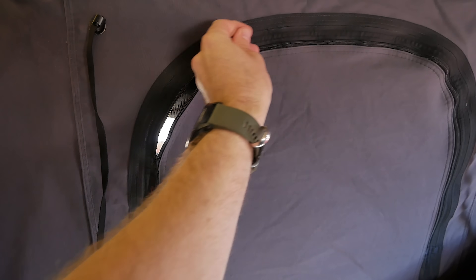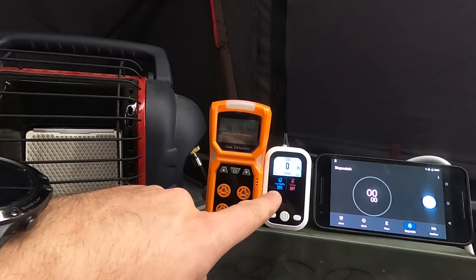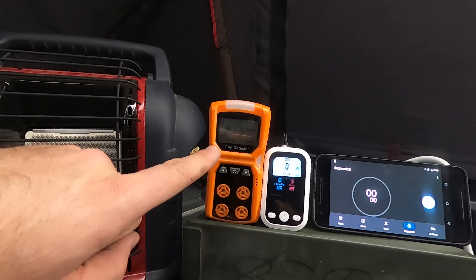What I'm going to do differently than when I normally camp is close up all the zippers. So we'll be in the iCamper totally enclosed, with no ventilation at all. I'm going to use a couple of sensors — one that detects carbon monoxide as well as oxygen concentration, and one that does carbon monoxide plus humidity and temperature. I'll run a 12-hour time lapse, taking one photo every minute, to see the highest carbon monoxide and lowest oxygen concentrations we get, and then compare that to what is considered safe.